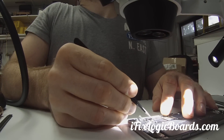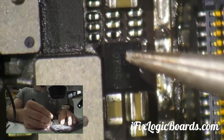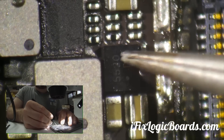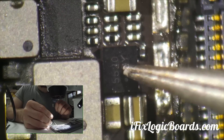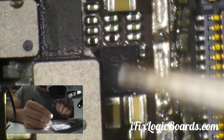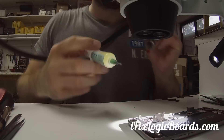So there are two chips here. This is the top booster and here's the bottom one, and this is the one I'm going to replace since it's not really performing. Once I remove it, I will probe the pads to see if there's any short on any of the lines.